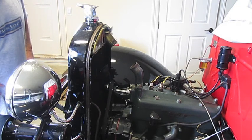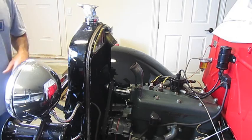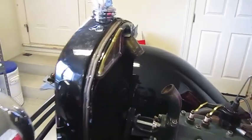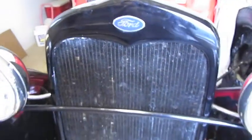Mine's a few years old so it doesn't need replacement, but if yours is older or deteriorated, now's a good time to do that. I'll show you where the support screws are for the radiator shell. Inside, there's one at the top and one at the bottom. On the other side of the radiator, same thing — one up top and one down below. So you'll remove those four bolts to take the radiator shell or cowl out, and then the two bolts on the bottom you'll do last.